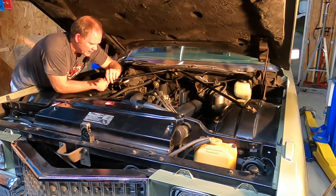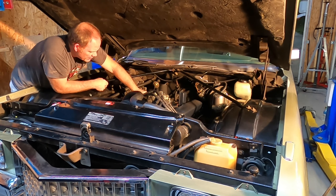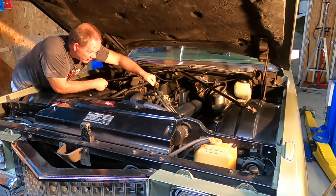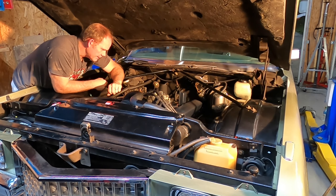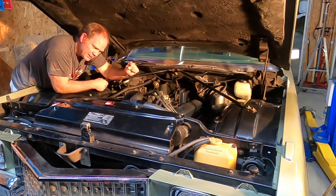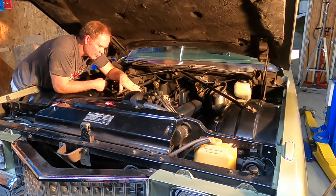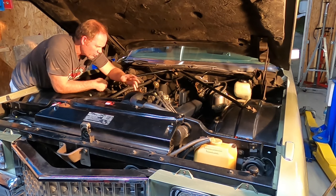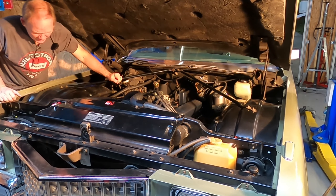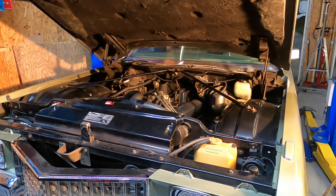I may go with the Sanden — let me know in the comments. I've got the choke bolted down, the carb torqued to wrist-tight, and the fuel inlet fitting snugged down. I used my special wrench on the brand new fuel inlet fitting and didn't want to overdo it. It's raining in the background — apparently we're in the rainy season here in Alabama.